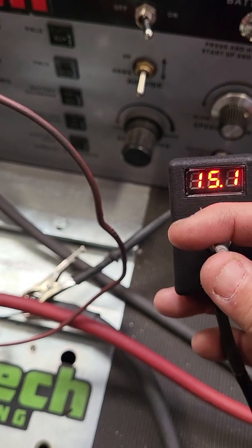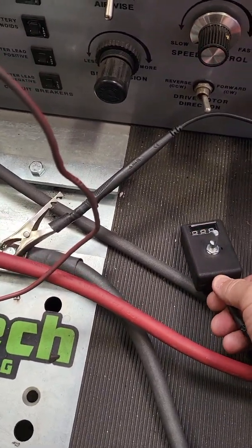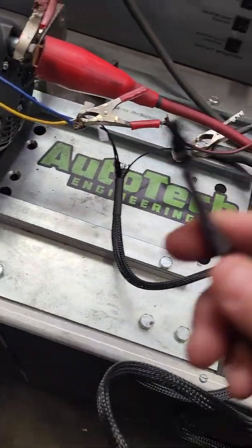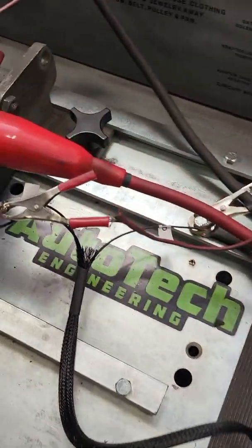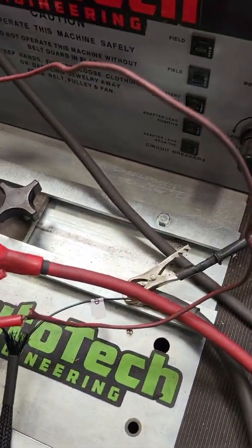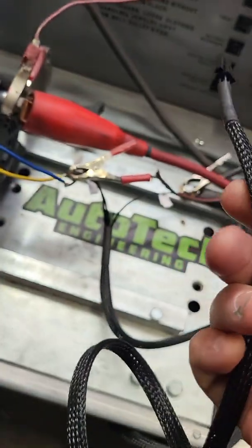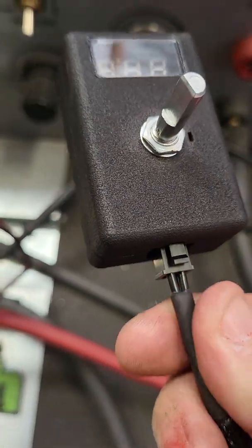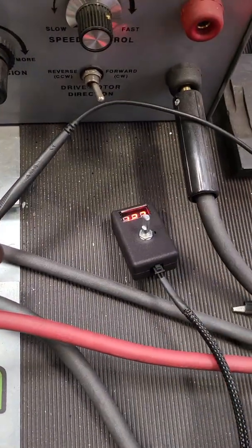It's going to be a very simple setup — we're making this real easy for everybody. The other added feature that's included is our harness unplugs. So when you run this through your firewall, following the AC lines through the firewall through the glove box, you don't need to worry about finding a big hole to run the box through. You just run this small little wire, well insulated, and it snaps right into place just the same way you unplugged it.